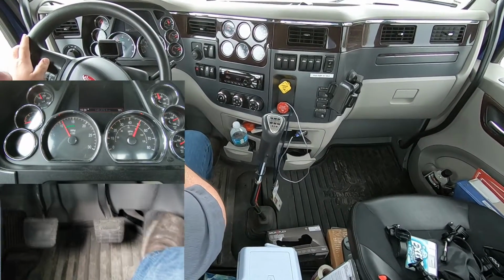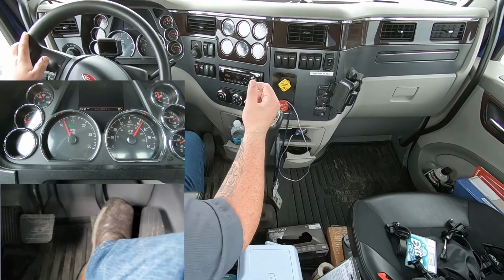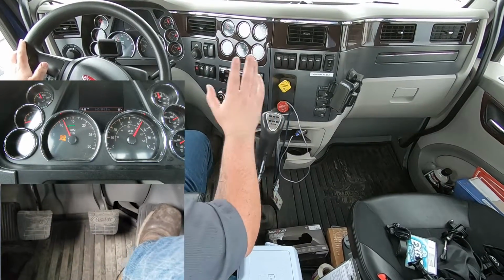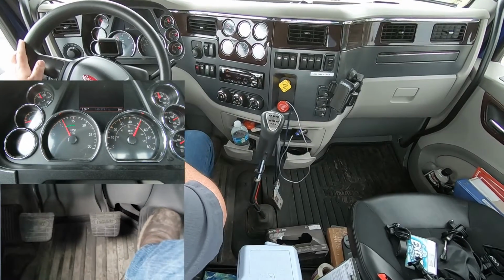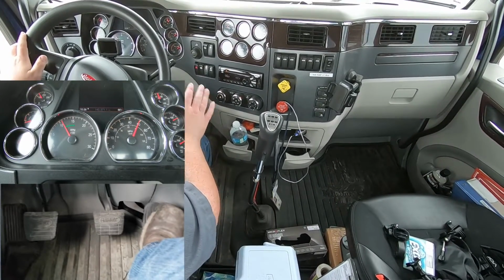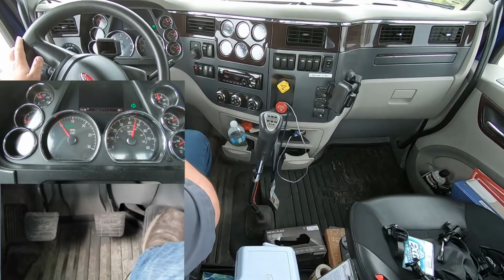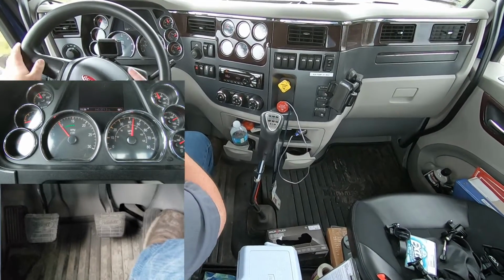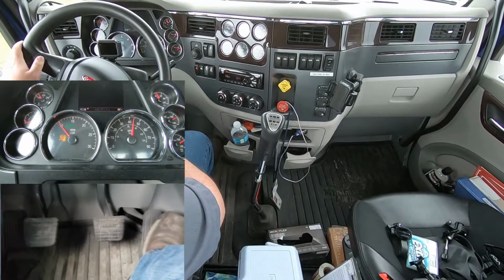And then when we go over the bridge, I'll downshift from 9th to 8th, and I'll show you kind of what I do for downshifting going uphill with floating. I wish I could put a camera on the floor, so you can see just how much fuel I'm giving it whenever I tap the fuel while downshifting. But I don't have a third. I need to get a third GoPro, I guess. My phone video is going to be horrible.